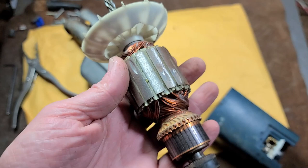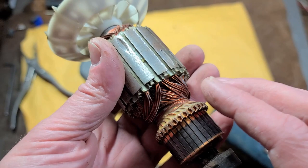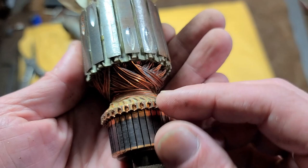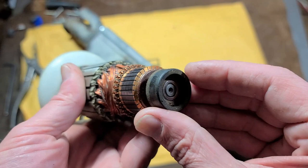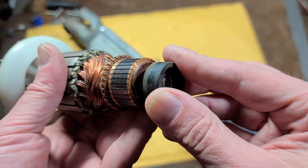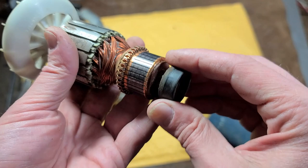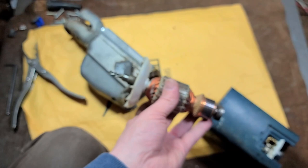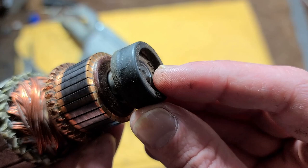Pretty decent motor, not a super thick layer of varnish. These more modern fans exist because the baffling helps direct more air, provides a greater air differential, and so you get more airflow. They could have put a little bit more protection on the intake side of the motor because this is where a lot of debris hits — and on rotary hammers and grinders especially, the amount of dust and grit will actually abrade the wires away physically. They did put some epoxy around the windings, and the connections are spot welded instead of just a tang folded over the wire, so this is a reliable mechanism. They've also put little rubber bumpers in there to reduce vibration for the motor and help the brushes last longer, but you've got to make sure you replace that rear bearing as soon as it locks up — otherwise this whole thing starts spinning and burning up the back of the housing.